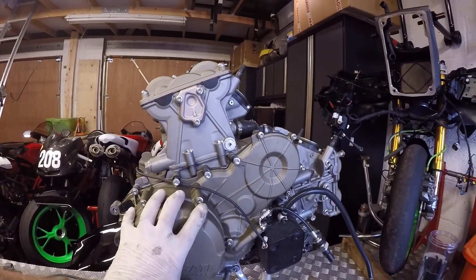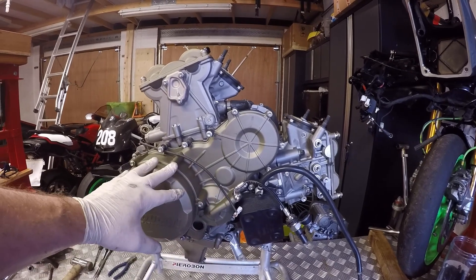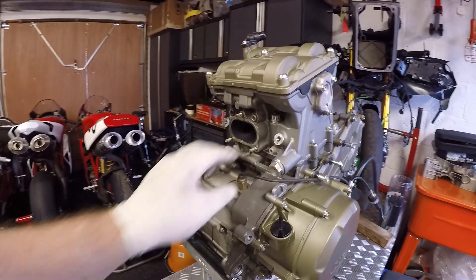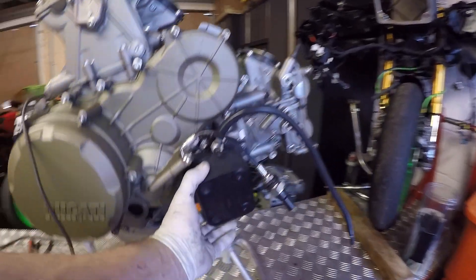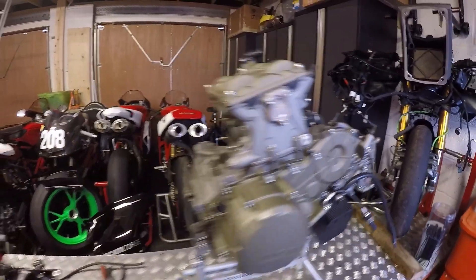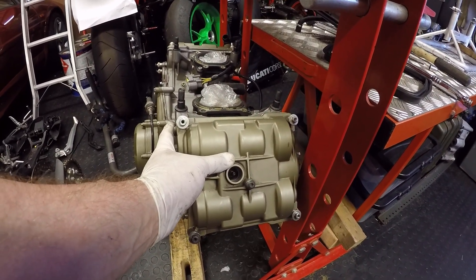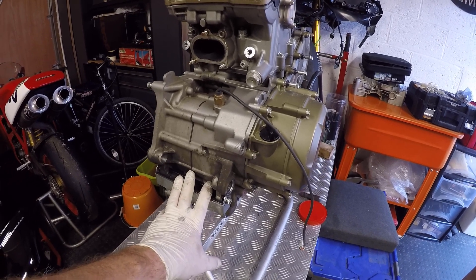That is effectively the engine removed in its entirety. Between today and the next video I'm going to start swapping over some of the little engine component pieces to make the engine swap go a bit easier. I need to swap the neutral switch because the lead's broken on the other one, get the oil cooler switched over, remove the exhaust support bracket, and then clean the 1199R engine so everything's in a known position before we put it in the bike.